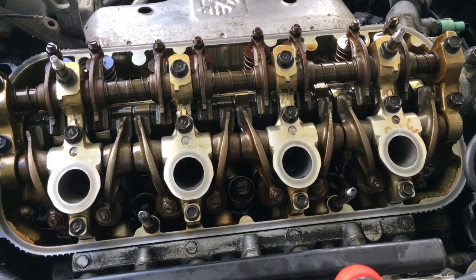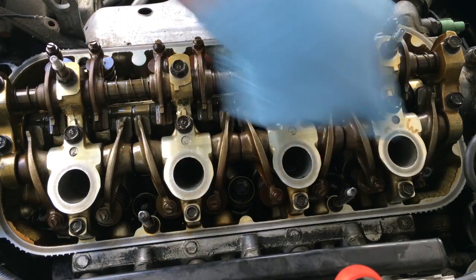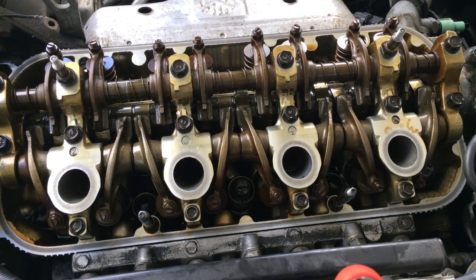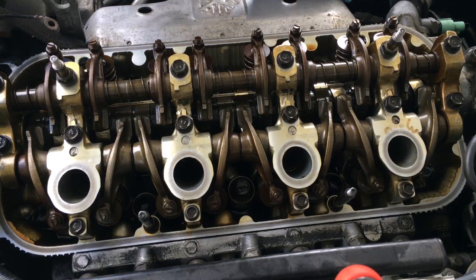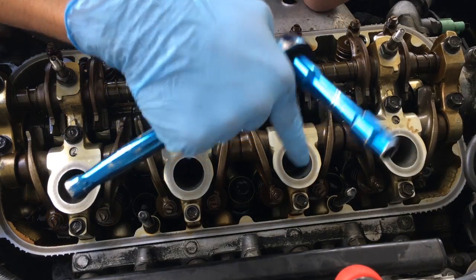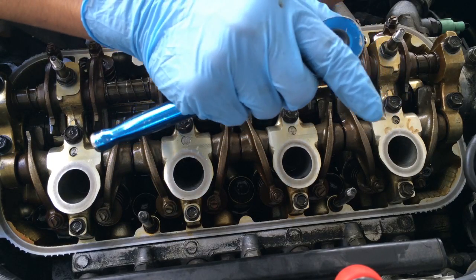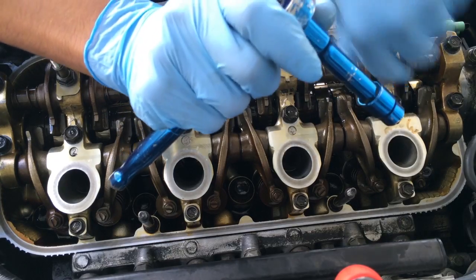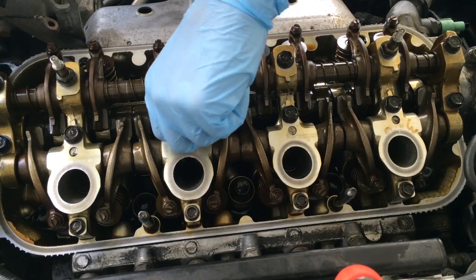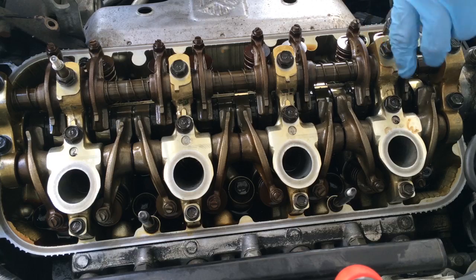Let me see. Yep. Y'all look pretty. Nice, nice. Alright, so now I'm gonna go ahead and grab the torque wrench. I don't remember them off the top of my head, or maybe I do. I think these are 9 foot-pounds, the 10 mils, the small ones. And I think these are all 16 foot-pounds. I have a screenshot of it, so I'll take a look at that real quick, and I'll be right back. Stay tuned.